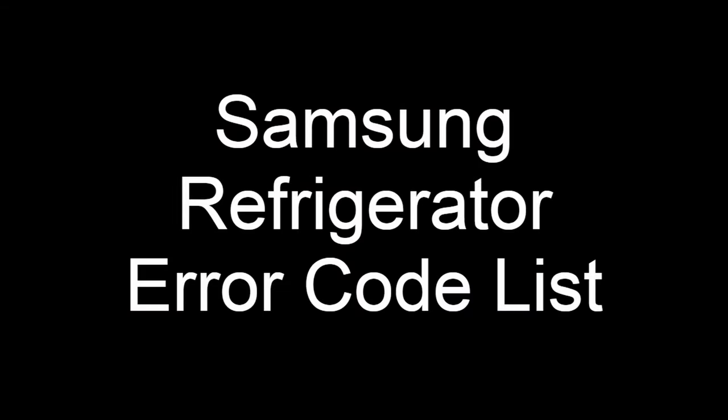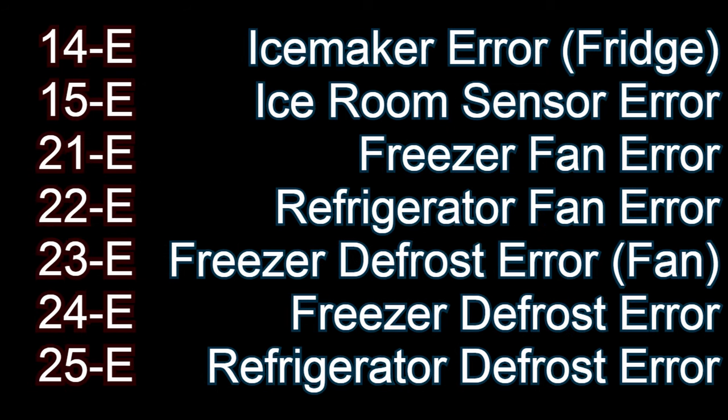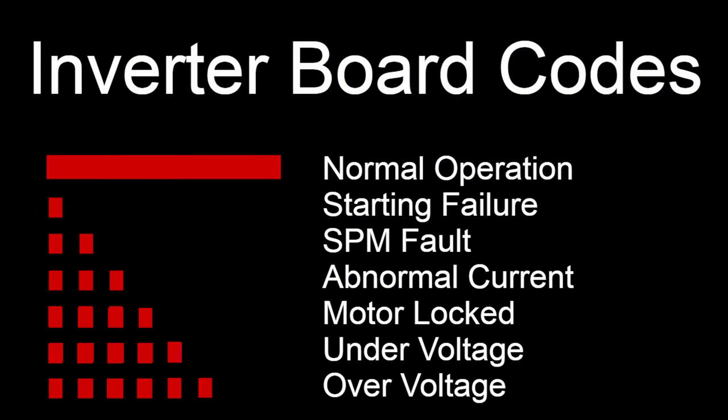Here is a list of potential error codes that could pop up on your Samsung refrigerator either before or during the diagnostic process. Each set of codes generally has a theme on what could be wrong regarding the refrigerator, freezer, ice maker, or another part of the refrigerator altogether. Many of these components can be tested from the circuit board with a multimeter to see if they are out of tolerance, revealing if the component is bad or accidentally unplugged. There are also codes that could be displayed on the front door interface, as well as the computer board on the back of the refrigerator, which could display additional codes through a series of red flashes — and this video has those codes as well.